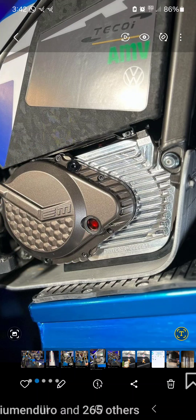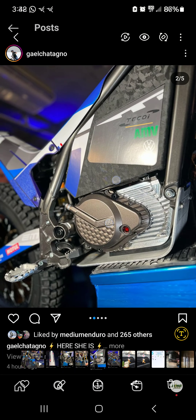They advertise a bigger battery with this platform, and right away you can tell — you see this gap between the battery and the stanchion or this bolt. The frame hasn't changed so much, but this gap right here is a lot smaller, meaning the battery from top to bottom is a lot bigger. If they're using 5,000 milliamp hour cells in the same space with like two inches more down there, you could possibly get at least 60 or 70 amp hours, depending on the cell configuration and what type of cells they're using.